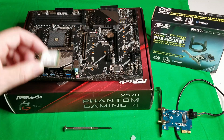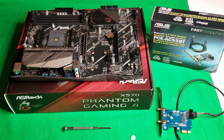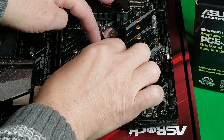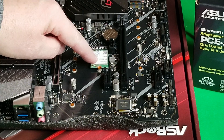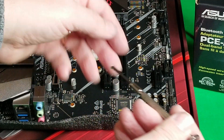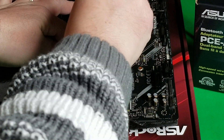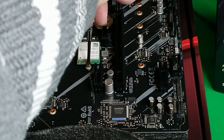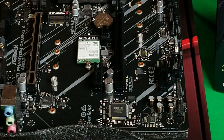Just disconnect them and go to your M.2 Wi-Fi slot on the motherboard — I'll zoom in so you can see. Line it up and it just pushes right in. Put it down, put your screw back in, finish tightening it all the way down, and that's it — it's secured. You now have a wireless motherboard, simple as that.